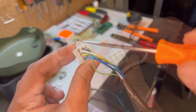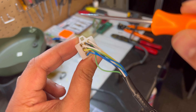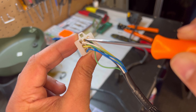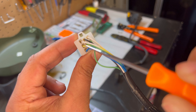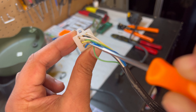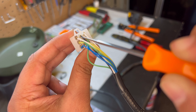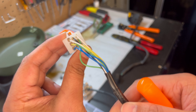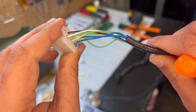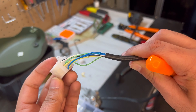A quick overview of the plug - with the little tab notch pointed up, you have both whites for your signals, the flashing negative in the middle, then yellow and blue - yellow on the bottom, blue on the right bottom, and two greens in the middle. To make it easier, I will pop up a diagram on screen so you can pause and reference it.